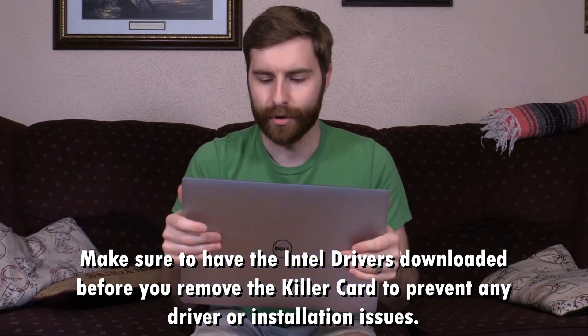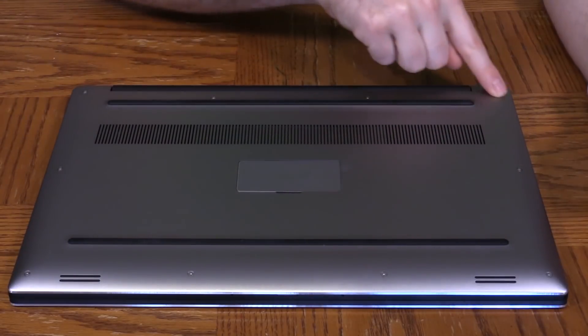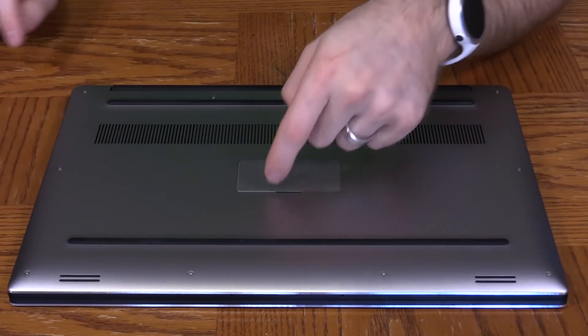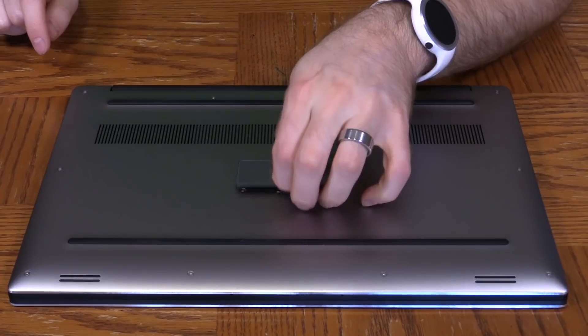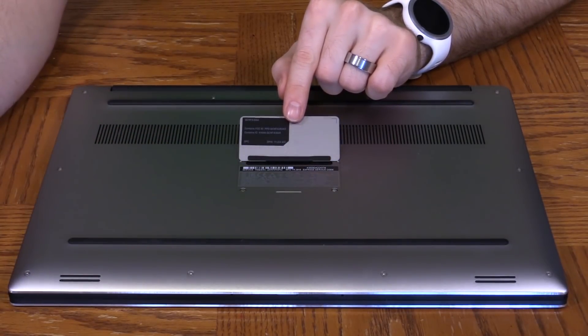Pretty much all the models are very similar. To do this, you need a small Phillips head screwdriver and a T5 Torx screwdriver. Please don't try to use a Phillips head on a Torx screw — you'll strip it and never get your XPS open. All around the bottom are your T5 screws, and under the Dell XPS icon flap with your computer information are two Phillips head screws. Remove all of these.